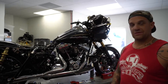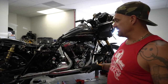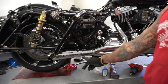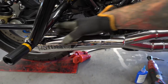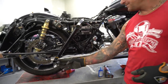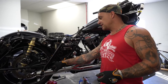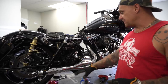The pipe is installed — I don't really remember where we left off earlier, there's been a bunch going on today. The pipe's all done and installs very easily once you get it in the right way. I am going to make a change though — this is a little too long in the collector right here. This is as far as the pipe will go down because it's butted up to the baffle on the weld, so I'm going to cut it back here so this slides a little way up to it. There's enough adjustment that it'll slide back and the mount will still be the same. I want to move it forward — they leave you extra so you can cut it and fit it to where you want. I'm at the very end of the adjustment and I've got about an inch and a half to two inches — I'll measure it out so I can just slide this forward. The mount is very adjustable.